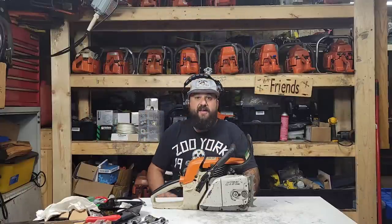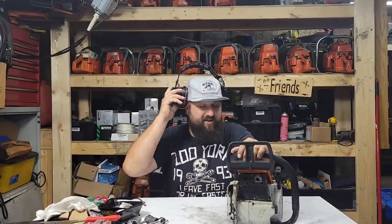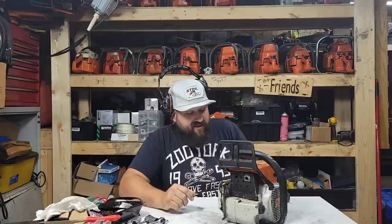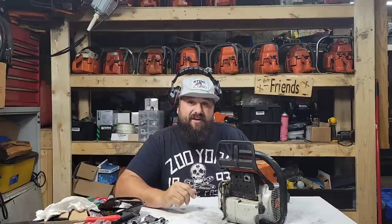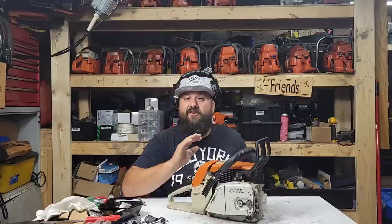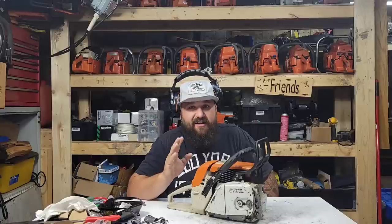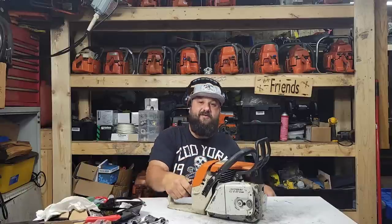Okay, so you guys see what I just did there? I gave this thing an eighth more turn on the low jet, and tomorrow I'll start it again. I'm a little bit strange with my break-in procedures. This thing's not fully broken in, friends. I don't expect it to start good, but I'd like three pulls, maybe four, before it pops. I don't know what that was. I think it was four or five.